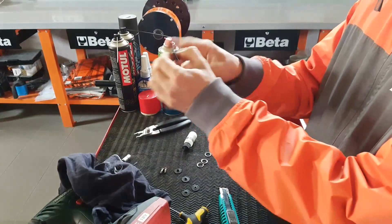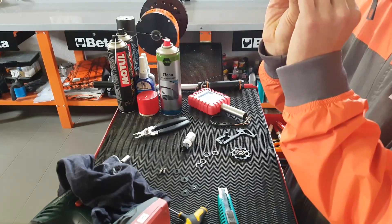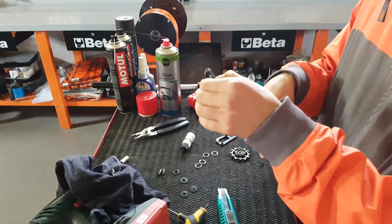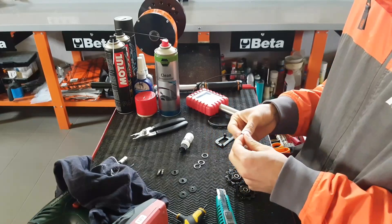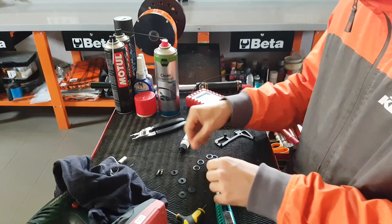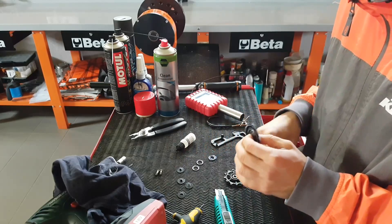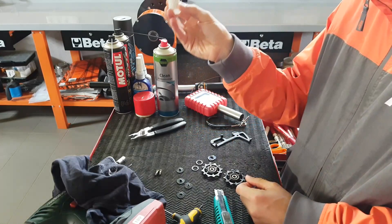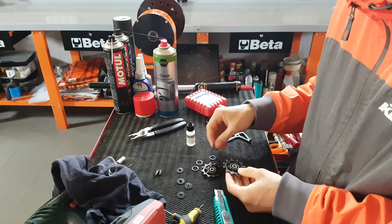The pulley wheels are now completely clean — basically as clean as new, and that's going to be good for friction. I've also cleaned all the seals and spacers, so everything is now ready for re-lubrication with 7x speed oil and then installing, so that's what I'm going to do now.